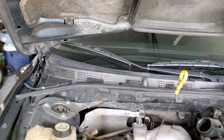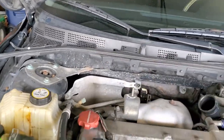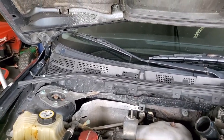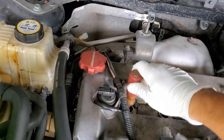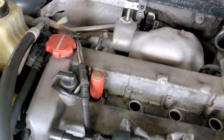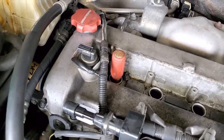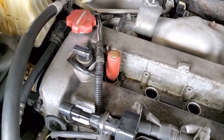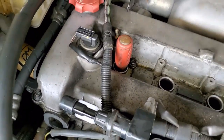I went the piston to top dead center and then a little past it, so it's on the downward end. I'm going to stick the longest screwdriver I have and just sit it in the piston like so. Two things we're looking for: one, we want to hear a metal-on-metal clank, and two, the screwdriver to go down. I know piston number one is good.